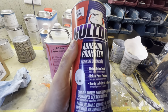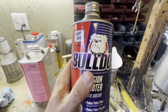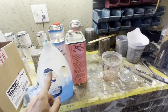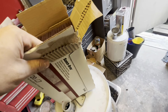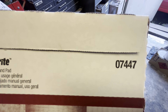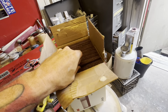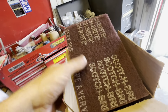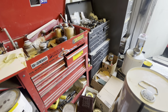If you're going to be painting plastic or metals, you're going to want some adhesion promoter. This is Bulldog — it helps make paint stick. But before we make paint stick, we need to clean it. Grab some Dawn dish soap or liquid dish soap. Then you're going to use scuff pads to prep most parts. This is Scotch-Brite, a 3M product — the burgundy scuff pads. You can also get gray scuff pads, but we use burgundy on everything. The gray is a little finer, but we use burgundy literally on everything.